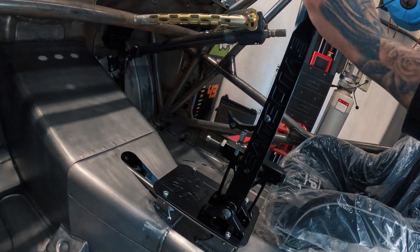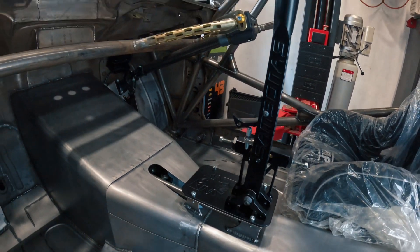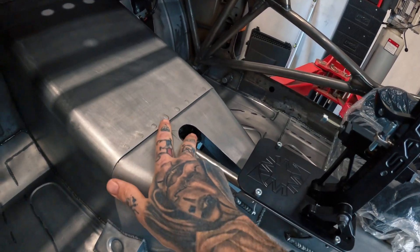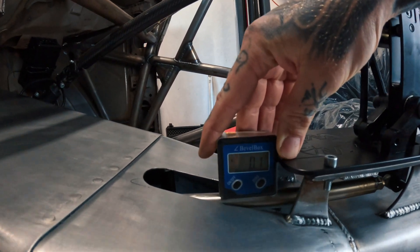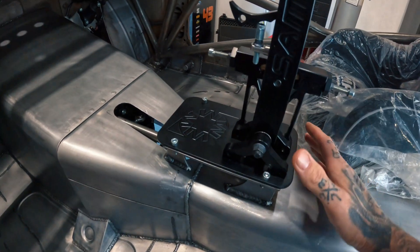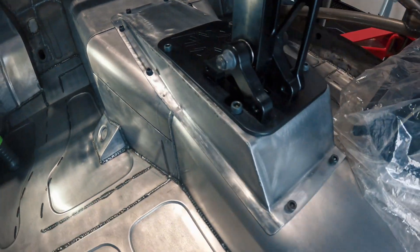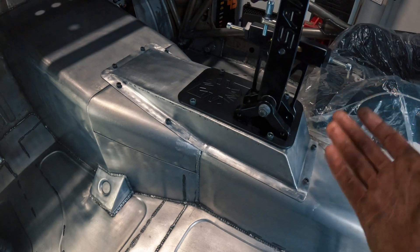That's the Samsona sequential gear lever - mechanical lever fitted off in its final position, mounted onto a solid base plate made out of three mil steel. As you can imagine, during competition and stages this will take a fair bit of knocking up and down the box, so it has to be solid. Selecting gears now - perfect. The link rod is docked to length, and it's got to be bang on level. Next up will be making the actual surround or capping plate for this area to dress it all off - just made from one mil sheet steel.